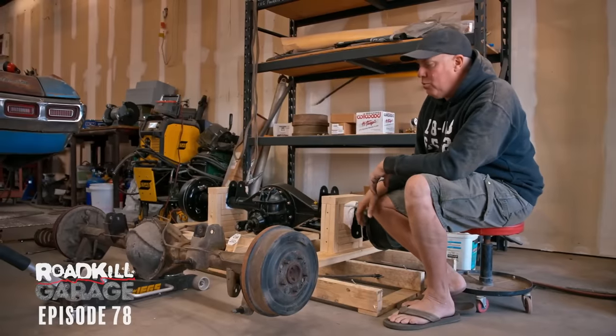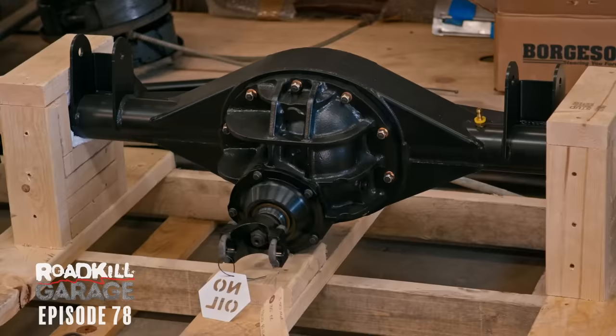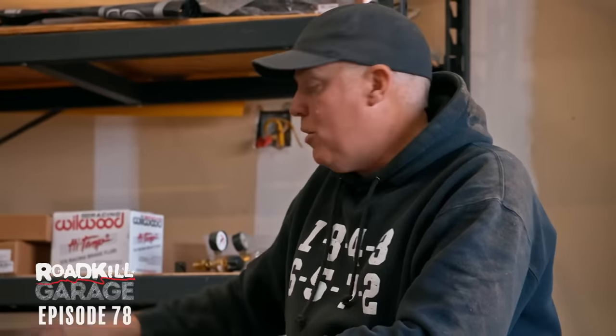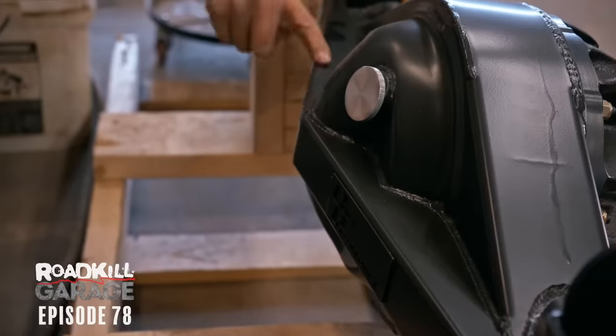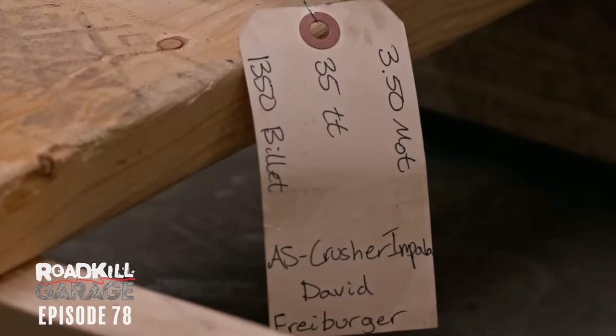And that's actually an NHRA requirement for vehicles with slicks. Also, if you're gonna upgrade a 12-bolt, you need to do things like weld the tubes, sometimes get thicker tubes, and this has all of that stuff already. Also, the guys at Quick Performance recommended a back brace on this thing because they knew that eventually I'm gonna put like 1,000 horsepower in this car.